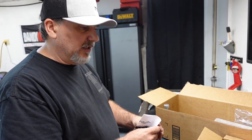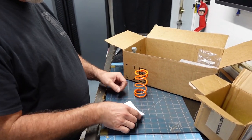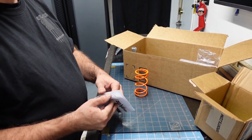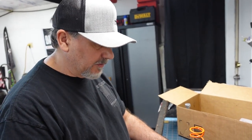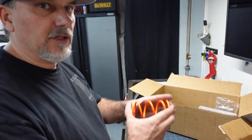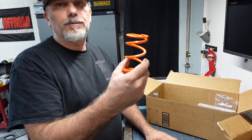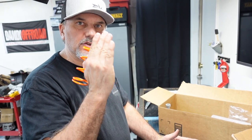And this is our, any guesses, comment below. I don't like the color, it's not green. They don't make a green one. Well, they need to. We gotta pull the clutch off, and this spring goes in, and what this does is it'll make the stall speed of the primary clutch 2300. We're about 2100 right now, so that doesn't work out with the two-step launch control stuff.